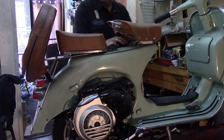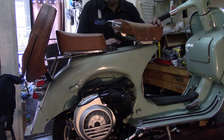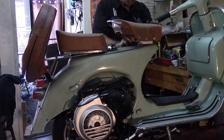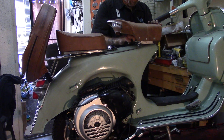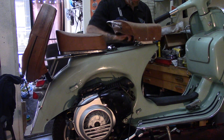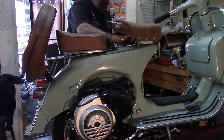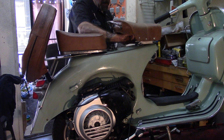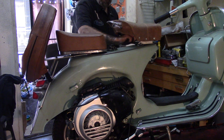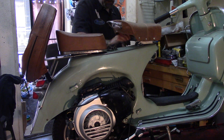First I'm going to take off the front seat. There are three bolts that hold the front seat on — here, here, and here. You don't have to remove all three. What we do is take off the back two bolts — I've already loosened them — and then loosen the front bolt.